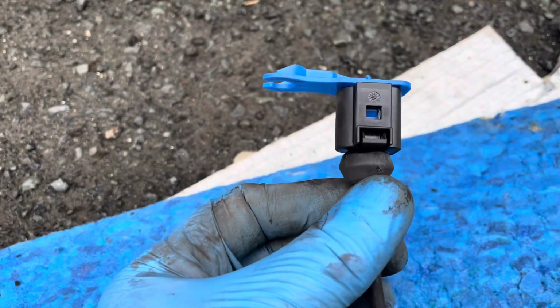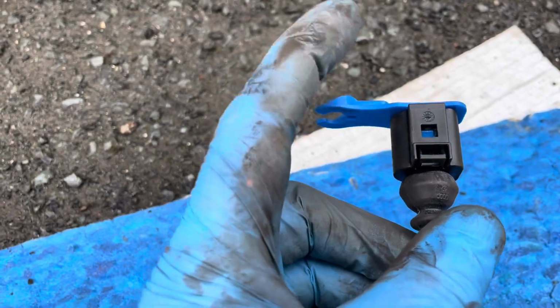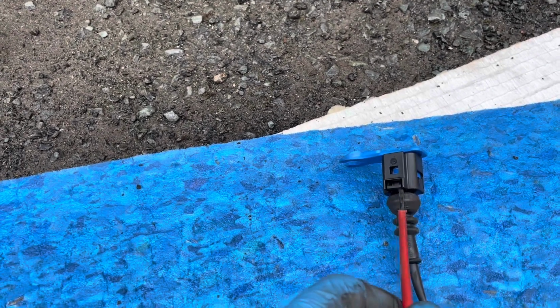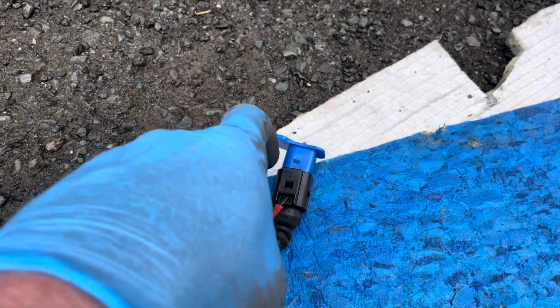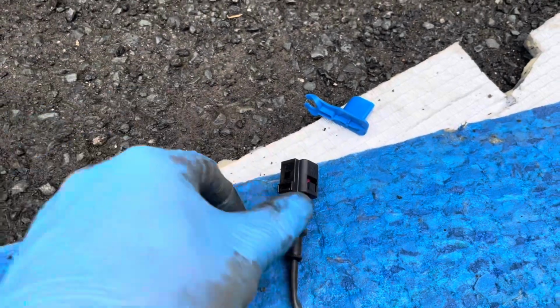Remove the plug for the brake wear sensor. The blue here is mimicking the connector on the chassis, and you've got to remove this plug here. So to do it, you pop a screwdriver into this area here and prise it up, and then it will release. So pop it in there, prise it up, and then that will release that. And then you can pull that across.